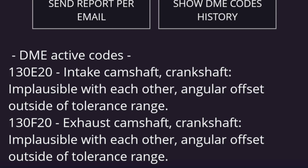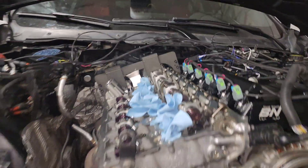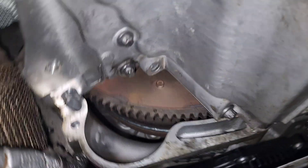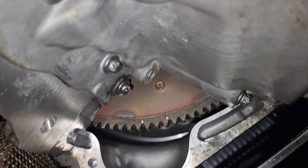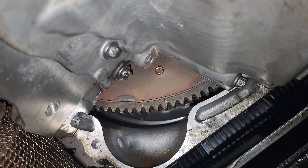I knew something was wrong. Through my research, a bunch of stuff was indicating crank hub spinning and things like that, which didn't really make sense for our cars. So I assumed it had to be something with the actual timing. We pulled the valve cover and lined everything up on the cams to see what was going on. And when I went under the car, to my surprise, there was absolutely no alignment hole on the flywheel. So I knew that the car was out of time.